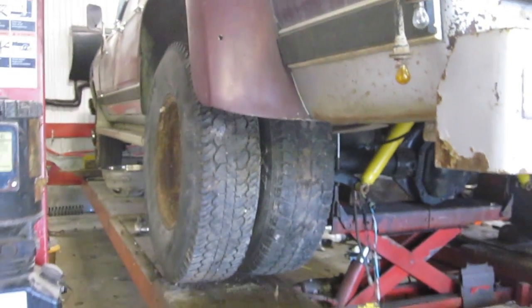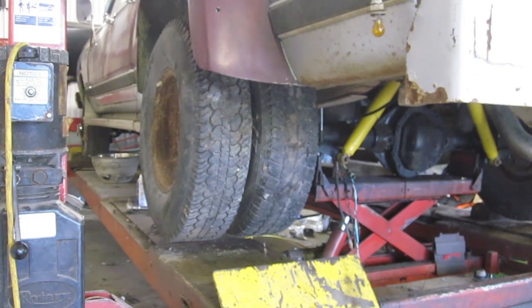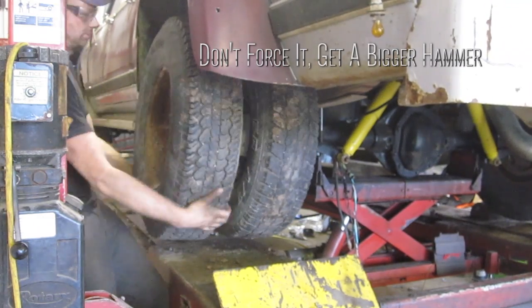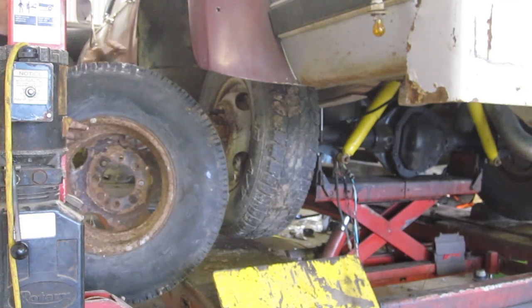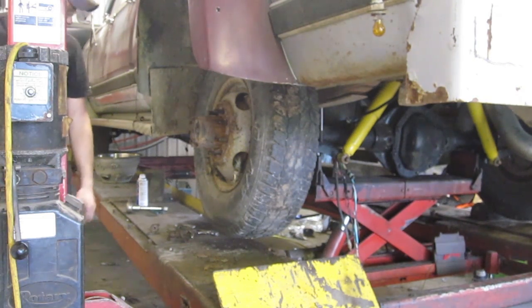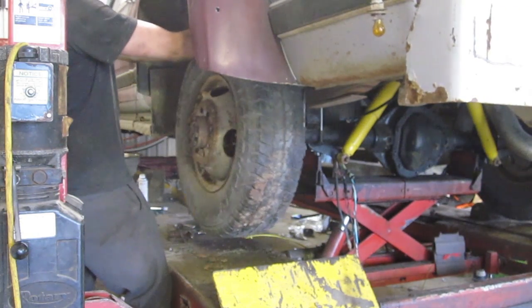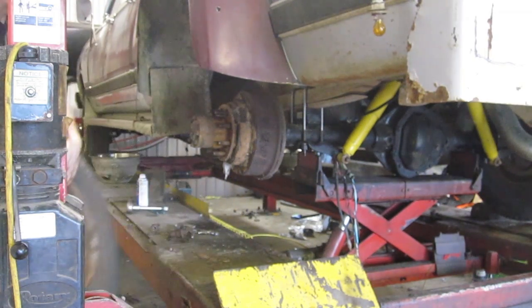We're gonna take our tires off and look at the brakes, put all new shoes on there, see what the drums are like, get the e-brake working again. And I think the last time these rims were off was the last time the Jays won the pennant back in '92. So it should come off nice and easy. Not bad. Look at that. They're not even rusty. We'll pull those drums off, see what's living in there. Some paint on that. Let's see what happens.